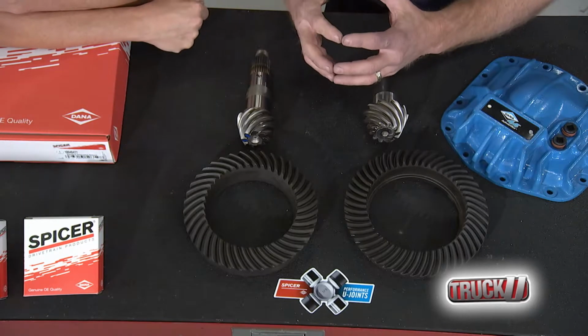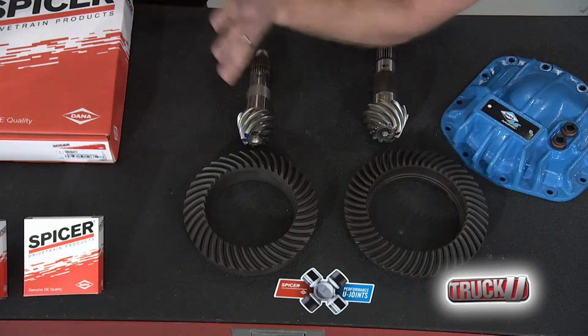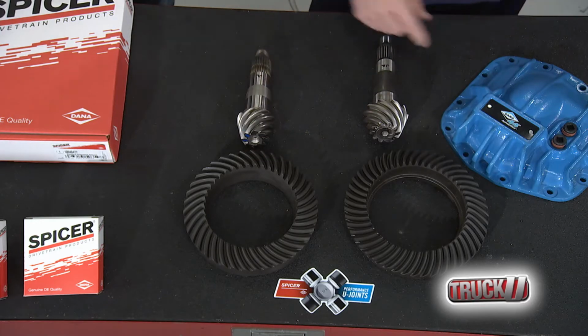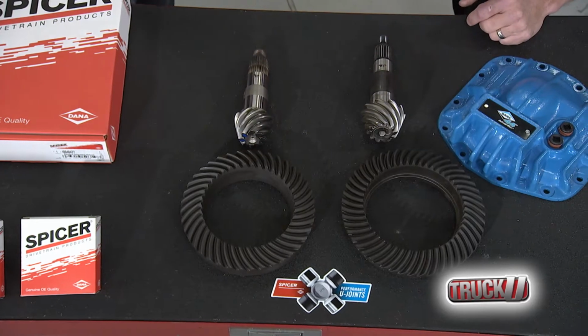So you've got a smaller package. You're going to have more clearance around your diff itself, so ground clearance is a thing. Plus, you're able to put more power in a smaller package and have less drag. That's going to be more power to the tires with less inefficiencies, and that's the way we want to go. So that's got a 410 gear. It's already got the Advantech in it, but now we're just going to change it to a 488. I see, while we're at it, dial it up a little bit, huh? I think it'll look great, dude.